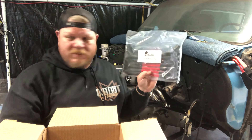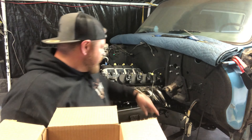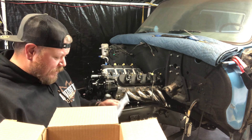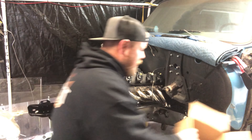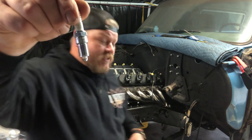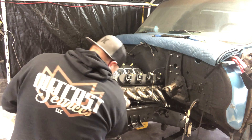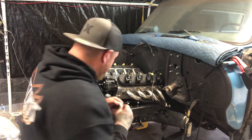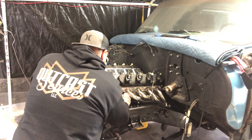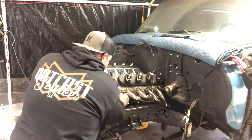Our NGK plugs came in. Apparently these are pre-gapped but obviously we'll check them. NGK Power — TR6, stock number 5141. These are nice. So this is what we're going to go with — the TR6s. We got all eight of those. We had also gone with some plug wires originally that I wasn't real happy with — they said 'for truck application' but I'm assuming that's a stock application where the wires needed to be longer.